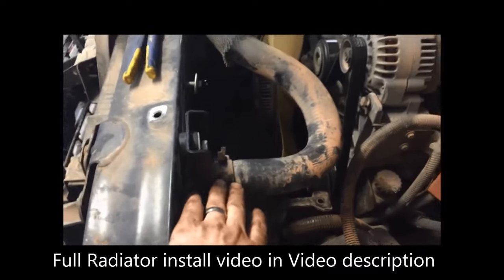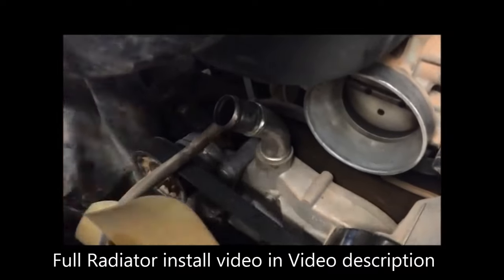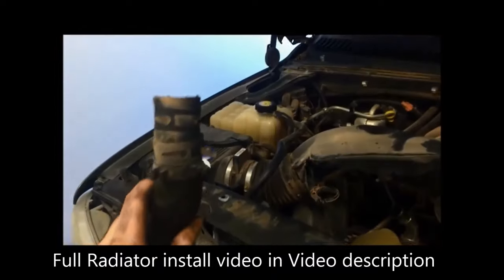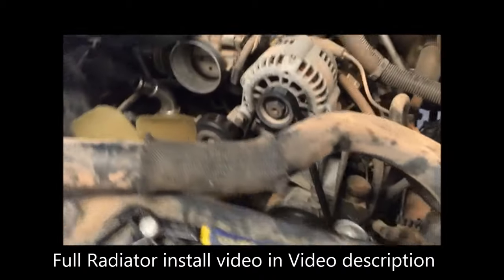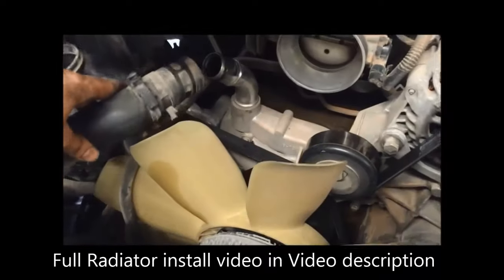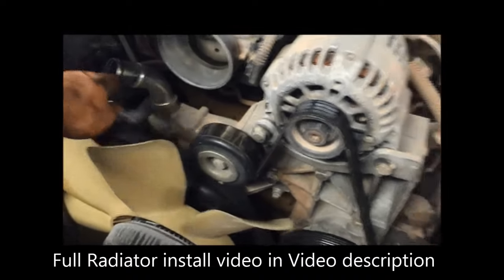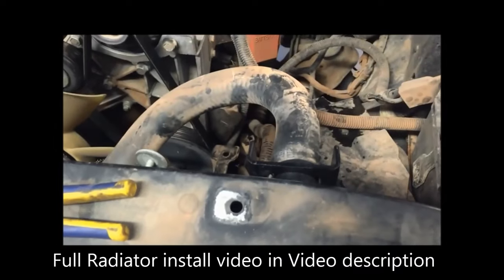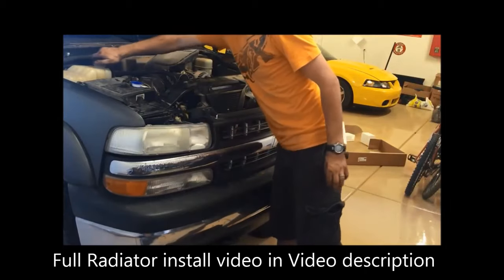What I've done here is attached this part of the hose, and I came over here where it goes into the water pump and took it off. So now I can hold this up and pour the coolant directly into this to fill the radiator. Once that's pretty much full, I'll take it off over here again, reattach this side, and pour the coolant in that way so that I have this level full and this level full, then put the hose back on.